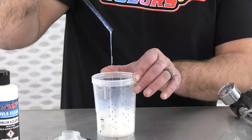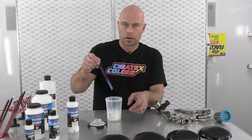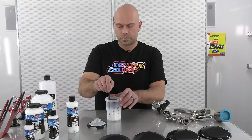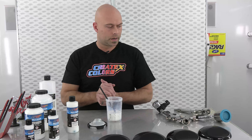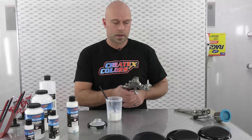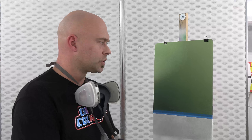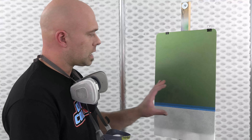10% — four ounces right there. Mix this very well. Water-based products are not like a solvent — when you hit it with reducer it doesn't break down immediately, you have to let it work. I want that nice even flow off the stick. You don't want it to hang like molasses, and you don't want it drippy — if it's drippy it's way too thin. That 10% is the sweet spot. Set this aside for about 10 to 15 minutes and you will notice a difference in performance.